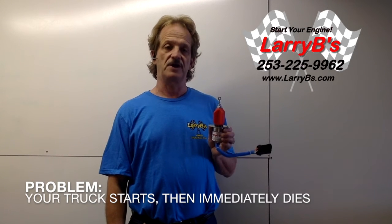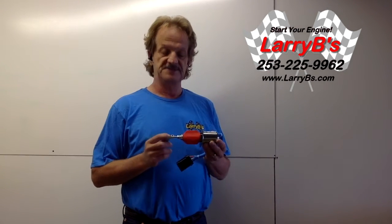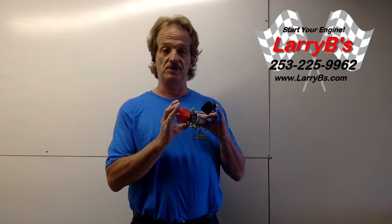If you're having a problem with your truck starting and then dying as soon as you let go of the key, the first thing I would check is the adjustment of the solenoid rod length. This solenoid comes from the factory with the rod adjusted all the way in. What happens is the throw of the lever restricts the plunger from going all the way to the bottom of the solenoid. When you let go of the key and it goes to the run position, the little magnet in the bottom won't hold it and it pops back up. When you're starting and it doesn't go far enough, when you let go of the key the solenoid switches to a small hold coil — that hold coil doesn't have enough strength to hold against the spring if the plunger is not all the way to the bottom.